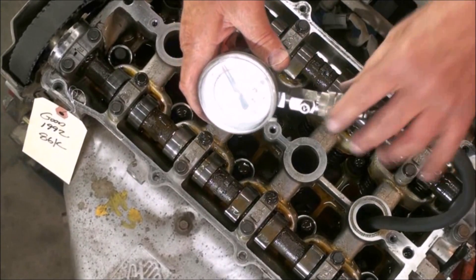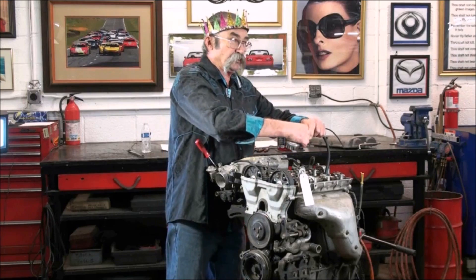Let's go over the general rules of a compression test. When the difference in the cylinders is more than 25%, the engine has a problem and will have a lumpy, rough idle. So if you have a lumpy idle, a compression test may be needed to confirm the vitality of your engine before you go chasing your tail down the rabbit hole trying to tune out that lumpy idle.